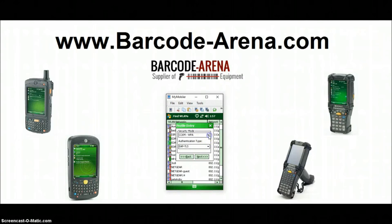Go ahead and select your network type — WPA2 Personal in our case. Authentication type is None. Since we're doing a mixed mode, go ahead and check that on. Sometimes your network security mode is going to be encrypted with TKIP, so double-check your router settings so you know exactly what it is. If you have one thing off, it's not going to work.